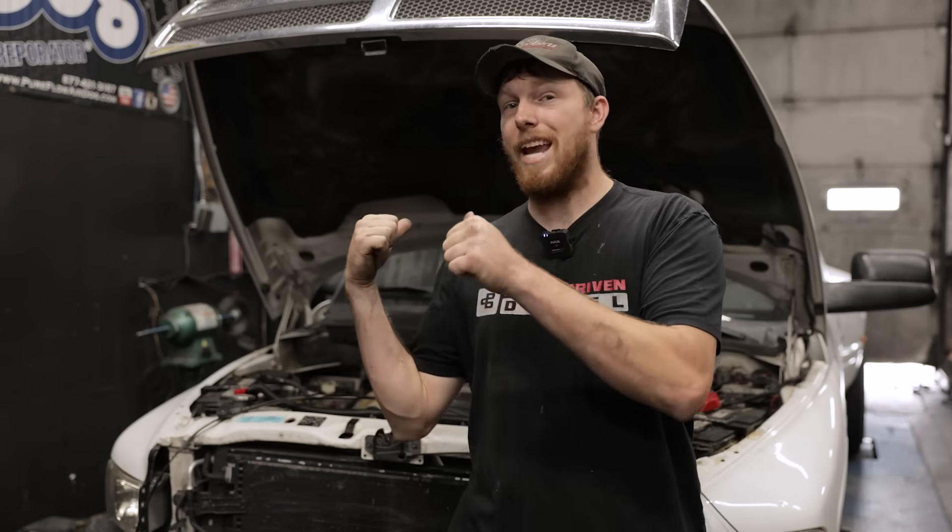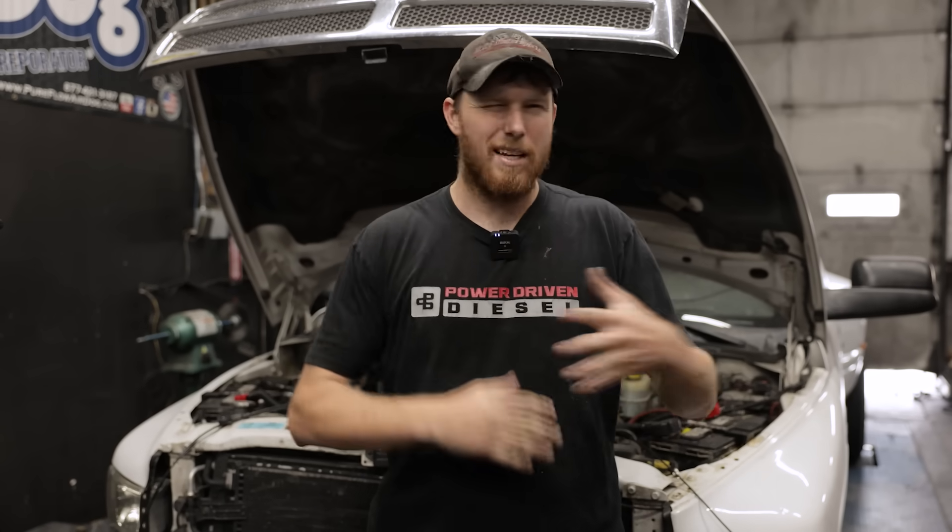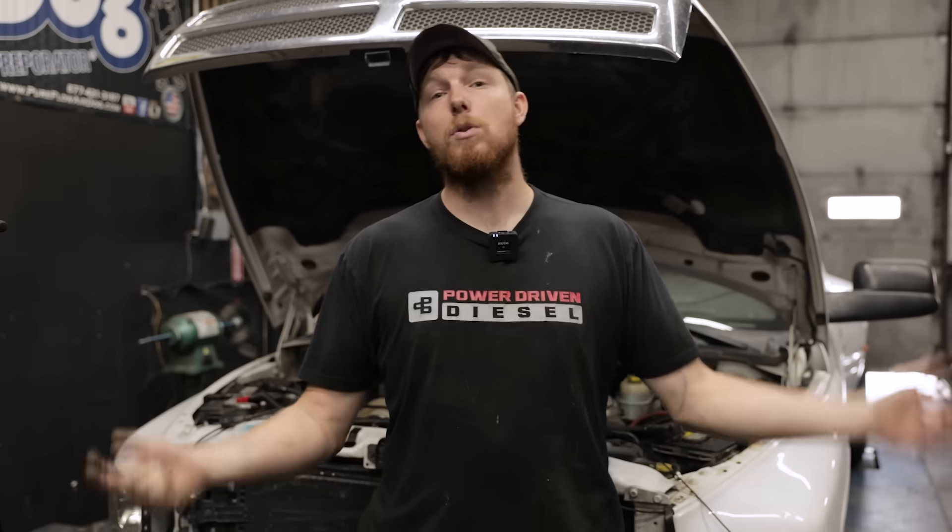Right now this truck has an HY35 on it and it's notoriously trash, so we're gonna be swapping an HX onto it because I'm really curious — I've never done the test before. Everyone says the HX is better, and today I'm gonna find out. We're dynoing the HY in stock form, then depending on how much boost it makes, we're going to tighten up the gate a little bit to try to get that boost up and see if it can more compare with that HX. Then we're swapping an HX35, bone stock off a VP truck, and see what they all do.